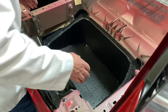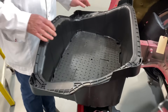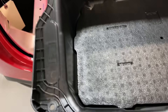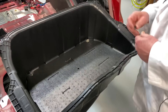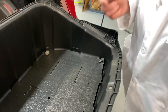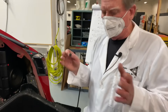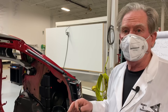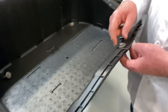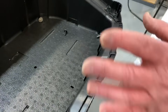Now let's talk about my absolute favorite little redesign in the car — the bucket. I love this except for one thing: there are five bolts. This one's the right size, and then this one is the same as that, this one the same as this, and this one the same as that — but why do I have one that's odd? One of the suggestions we have for every customer is to try and make the bolts the same size. Your operators don't get confused, and it doesn't cost any more money. I don't see any reason why we'd have to have this other bolt.